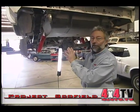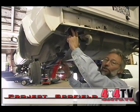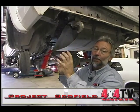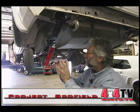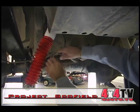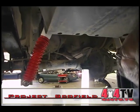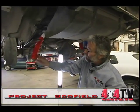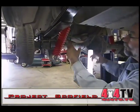We finished putting the lift on the rear of the XJ — fairly simple, fairly straightforward. A couple of things we found: check the condition of the bushings on the top of the shackles. If they're really bad, they come as a whole shackle assembly from the dealer for about $30 to $40, so it'd be good to replace them while you're there. We also had to be careful with the brake lines — we made a little extension to bring things up, but it has to be mounted solid. The e-brake lines are okay; we just pulled the springs a little to hold them up and keep them away from the muffler. Amazingly, we probably spent as much time on the bushings and hardware on the shock ends as we did putting the springs on.